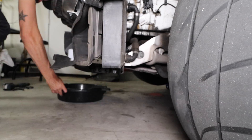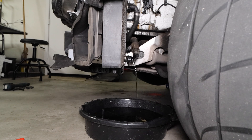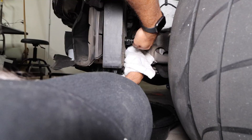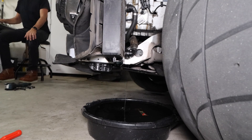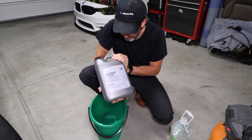We want to make sure we get all the coolant out — just take your time on this part. It does take a good half hour to get both the high temp and low temp systems fully drained. I went back to the passenger side once I jacked it up on that side to get the other angle, and then did the same on the driver's side. I had the car jacked up on the passenger side to get the coolant out on the driver's side, then came back around and jacked the driver's side again to get the remaining coolant.